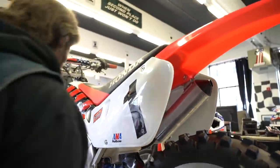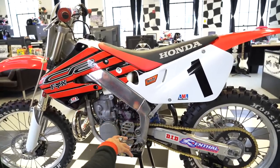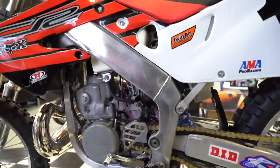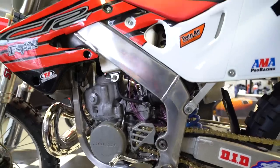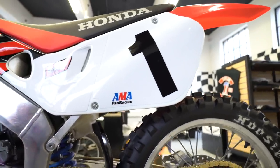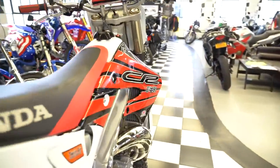Going to the heart of the beast, you can see the engine is in excellent condition. The Wizard went through this — cleaned out the gas tank, cleaned out the air box, put a brand new air filter in it, took the carb apart, cleaned the carb, went through all the jets, made sure everything was perfect. Reassembled it with a new gas petcock and a new fuel line, and VP Racing Fuel mixed at 32 to 1 with Castrol 927, so it smells fantastic. Not only does it sound and run and look fantastic, but that typical two-stroke Castrol 927 and VP smell — it's like better than candy in the morning, better than coffee in the morning. I've got a lot of experience with two-strokes from this era, raced for years. This bike can't have more than 20 hours on it.